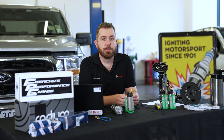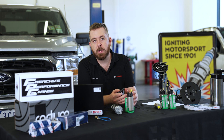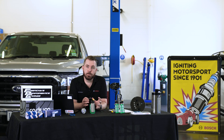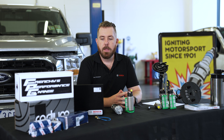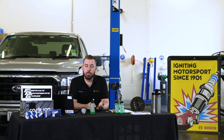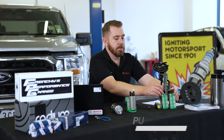Since the actual amount of fuel injected is primarily controlled by the injector opening time, fuel pressure is ideally a constant, which is set by your tuner or the original equipment manufacturer. Modern race cars will often monitor fuel pressure as an important indicator of engine health and expected performance. This fuel pressure determines the fuel volume that can be delivered — simply put, the higher the fuel pressure, the lower the volume of fuel that can be delivered. Bosch Motorsport specializes in fuel pumps that can deliver high volumes of fuel even in high pressure fuel systems. All Bosch pumps have data sheets mapping their fuel volume flow rates at different pressures — most commonly 3, 4, or 5 bar, occasionally going up as high as 8 bar. High power vehicles or those running ethanol, boost, or a combination of the two might find that a single high flow pump isn't enough, in which case there's always the option of installing a dual fuel pump system.